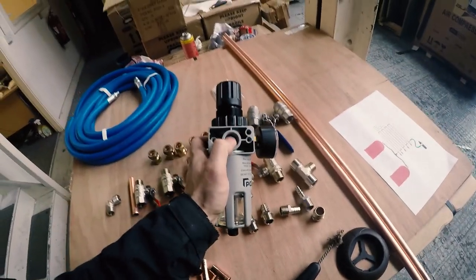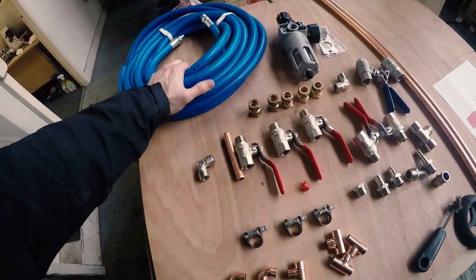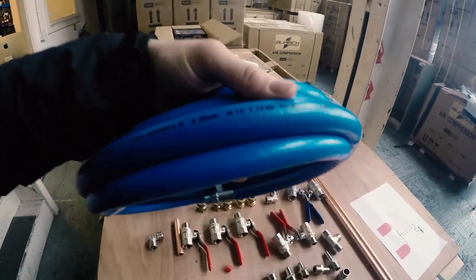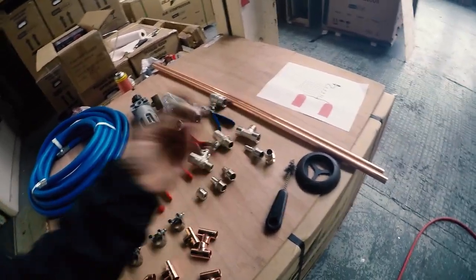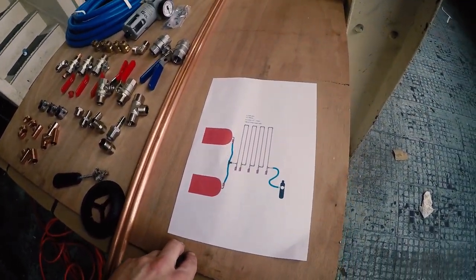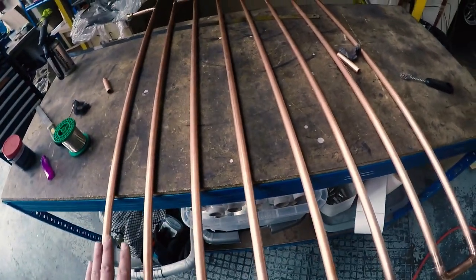Over here I've got a half-inch port water trap — quite a nice high-flow diameter. And that's the flexible hosing we're going to be using, which is 13mm internal diameter. That allows quite a lot of airflow and volume, which is great for your impact wrenches, HVLP spray guns, DA sanders and things like that that require a lot of volume. Running straight out the tank, you can increase the volume significantly compared to a restrictive filter regulator valve.